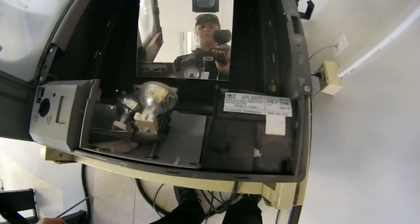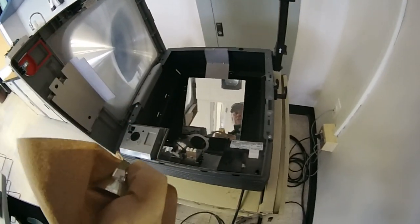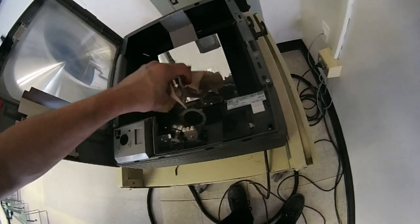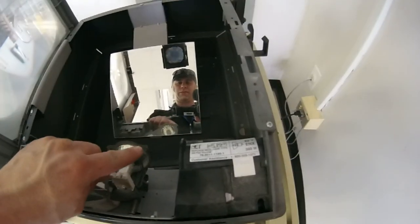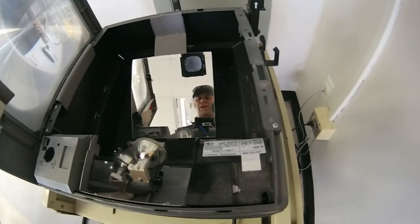We're just gonna replace the bulb that's done — you can see that one's nice and black. Here's a word to the wise: you never touch these bulbs with your fingers, because the oil from your fingers sticks to the quartz of the bulb. Once it gets hot, the bulb will want to fail, or it could actually explode — or implode. So when you're putting these in, be very careful you don't get any grease on them. The outside housing would probably be fine to touch, but we don't risk that anyway. Just push that lever back down, shove the bulb down in there — it clips in. Bang, ready to go.